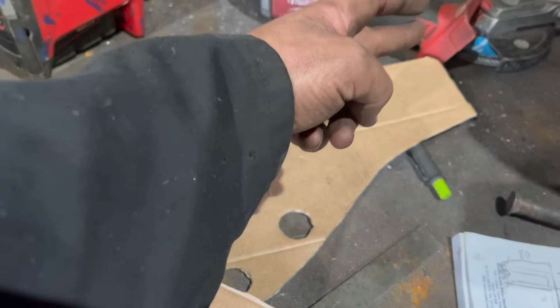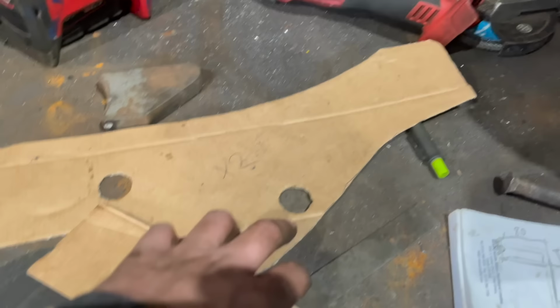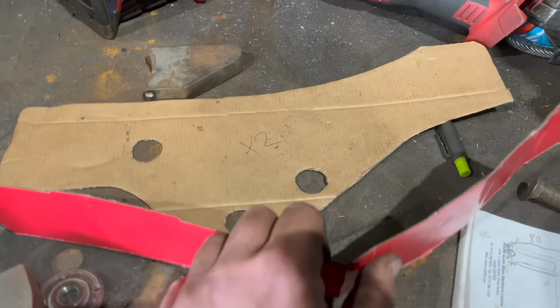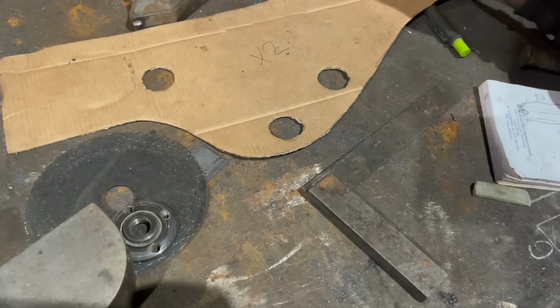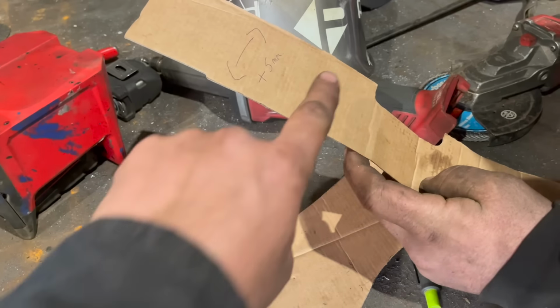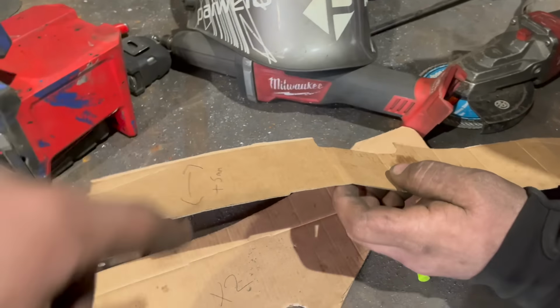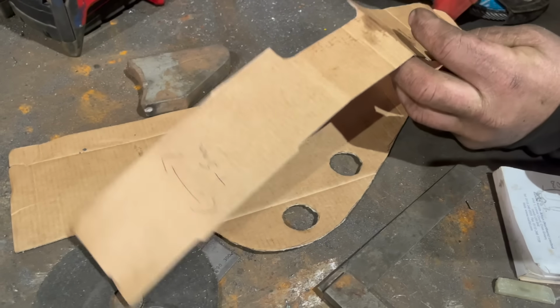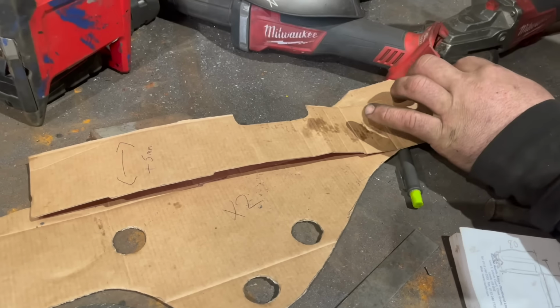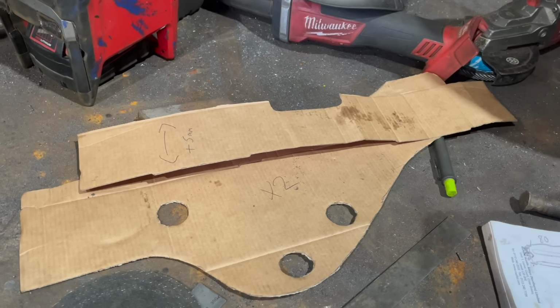So it's only literally, we're welding all here, and all that ends at a bracket, you see. So I'm going to weld up to the bracket, and then this is a bit that will join the two. Is there steps on it, or is that just part of the box? Yeah, forget about that. Don't cut that out. Just make that straight bit five mil wider. Yes, and then I'll manipulate, bend that round to suit the shape. Yeah, that'll do.